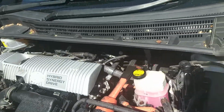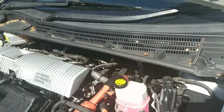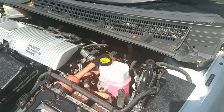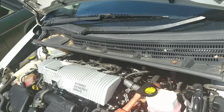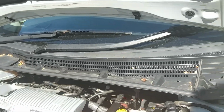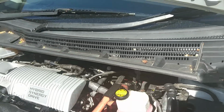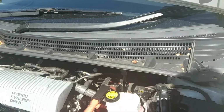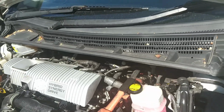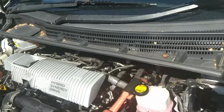So there you have it, one happily running Prius. Now the nice thing about a Prius is that because the hybrid battery does all the heavy lifting, those little power packs actually start these cars very well. In fact, a 12 or 18 volt battery drill power pack, as long as you know where to connect the wires, will be just as good, because again, it's not doing any great heavy lifting on these. It's only basically booting up the computers and the brake compressor.